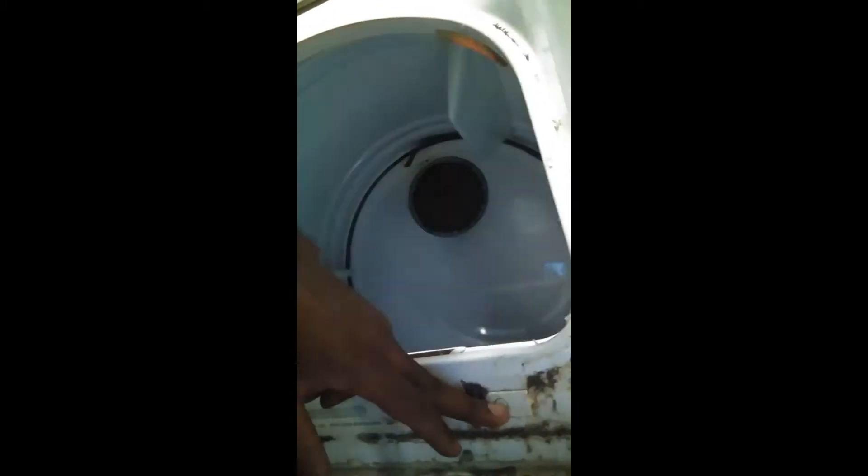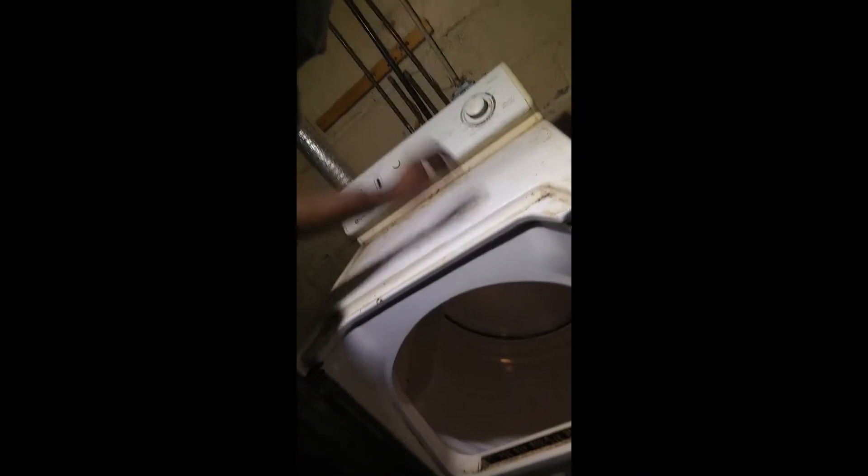Okay, so now we can see the light is on. This door button right here where my finger is — you have to hold that down. That's actually what's more than likely going to turn the dryer on: when you close the door and it presses up against that button, the dryer knows it's closed and it's gonna start rolling. I haven't turned it on yet — we're gonna find out together.